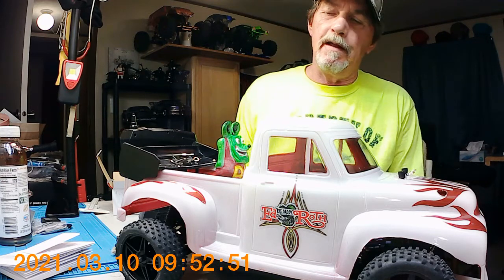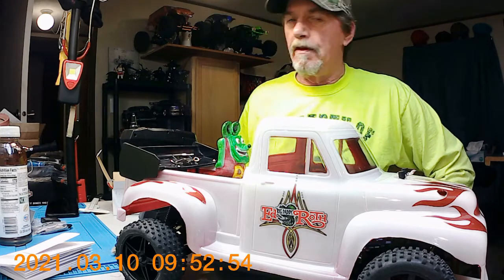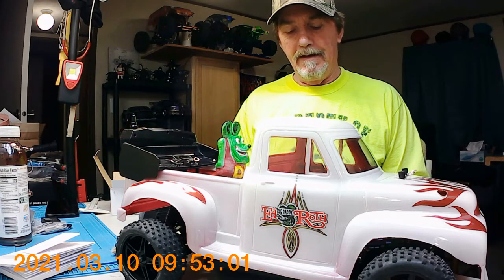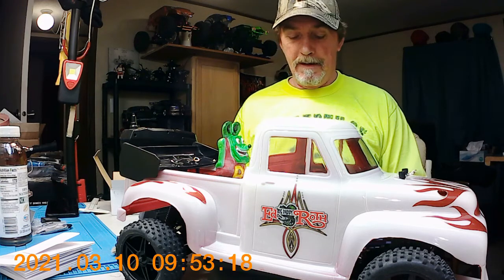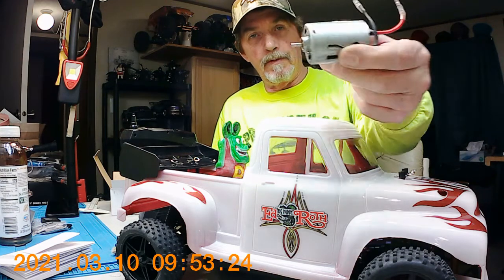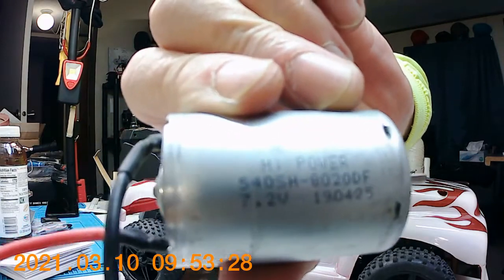I had to do a little bit of motor shaft shaving and move the ESC because this can is a little bit longer now. According to Exceed's website, the motor that comes in these buggies is a 550 can. When you pull this motor out of this buggy, it tells you high power. Oh yeah, Exceed also claims that these are 2 to 3S LiPo capable by moving the jumper on the 1060 ESC, which the ESC really is. But the motor's not. This is a high power 540 short can, okay? It is a 540 short can,